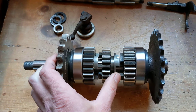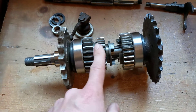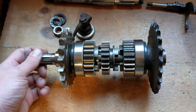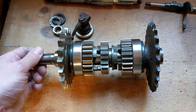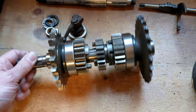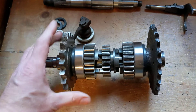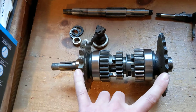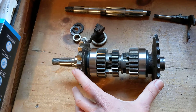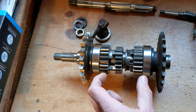When we select low speed, we move this dog across and that locks this sprocket to the shaft. Neutral would be in the center, and I'm planning to use a hand change for neutral. Then moving the dog to the right locks the other sprocket to the shaft. Obviously this needs to be put into a gearbox, but those two sprockets are not very far apart, and I'd rather have a back wheel that's a bit wider than a bicycle tire.